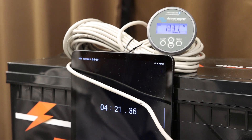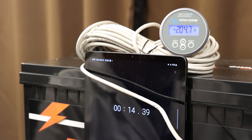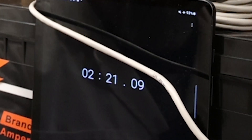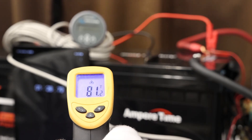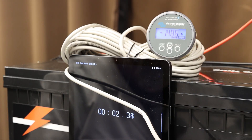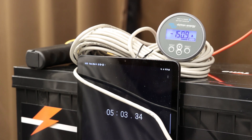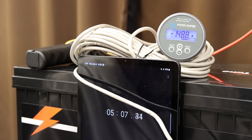Just over four minutes it took to cool down. The battery is back online at 13.3 volts. Since we had thermal shutdown at 300 amps, let's try 200 amps. Temperature readings: middle of the battery 80°F, top 78°F, positive terminal 108°F, negative terminal 111°F — all very reasonable. Now at 150 amps — five minutes at 150 amps, no issues. The battery is able to handle that load for at least five minutes.